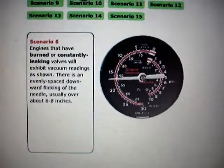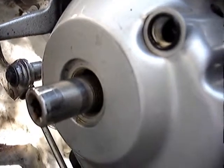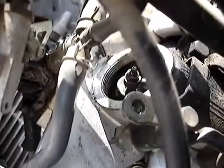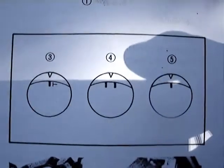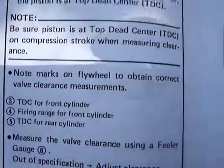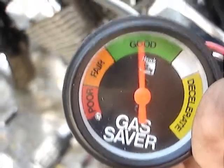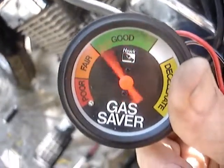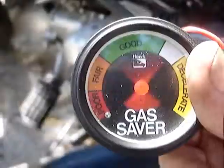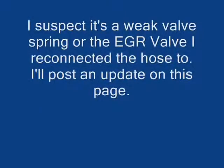So what I'm going to do now is check the valve adjustment. Take this garbage off, take off these covers, remove these - both sides. Remove those two plugs; that's 17 millimeters. Make sure you get all these areas cleaned out on all four before you remove those plugs, because garbage collects down there - get some carburetor cleaner sprayed in there. Your numbers are 3 to 5 on the intake and 4 to 6 on the exhaust. And that's how you do it, so I'm going to do it now. Not good. Not good. Not good. I'm seeing both sides - not good.